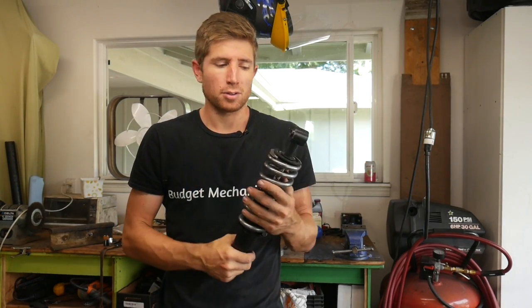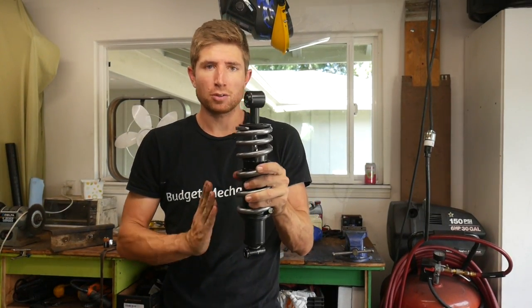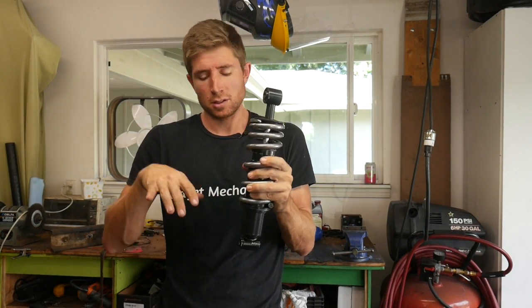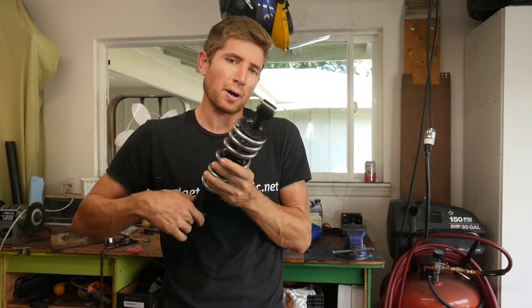Just please be careful. There is a lot of pressure in the spring. You want to make sure that you're lifting it straight up and that it doesn't start falling over one way or the other. If it does, you need to go back and center it up again. Otherwise, it'll pop out on you.